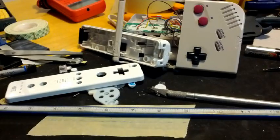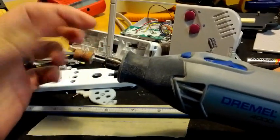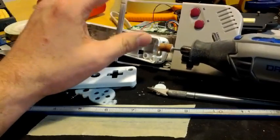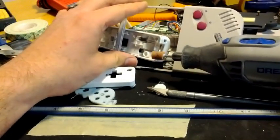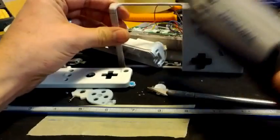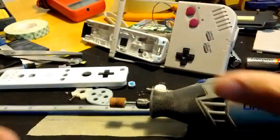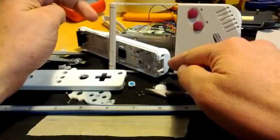What I used was any grinding wheel, which is basically a sanded thin disc. You go along and basically cut very close, but not extremely close — if you make a mistake and go over it, you only get one shot at this or you wreck the whole appearance of the Game Boy. You cut along with this grinding disc all the way along here — it melts the plastic a bit. You cut along in here and in here, and you basically get the shape cut out. You take the corners out, then you can remove the piece. It's just this ugly-looking thing and you think it's terrible and you'll never make it look nice. But it's not true — it's fine, as long as you can see your scored lines.